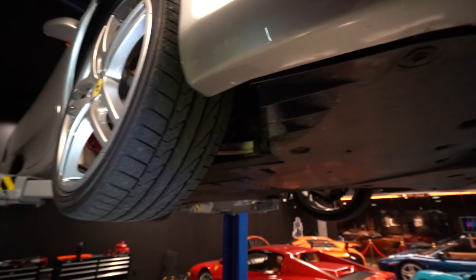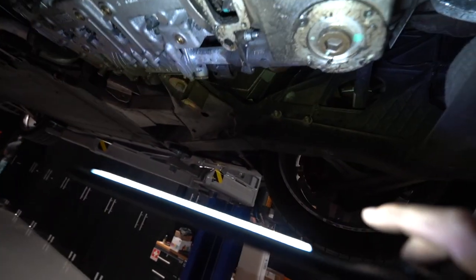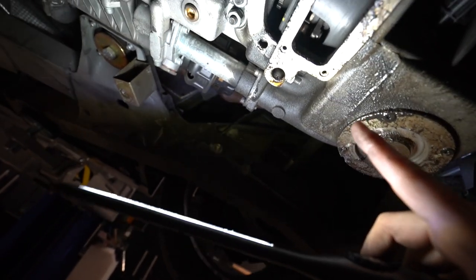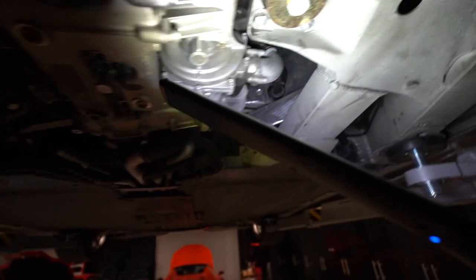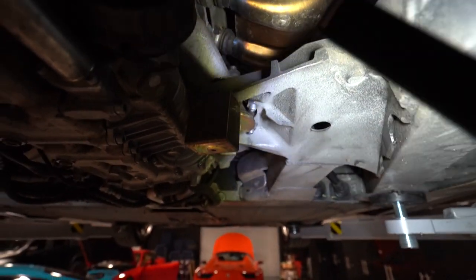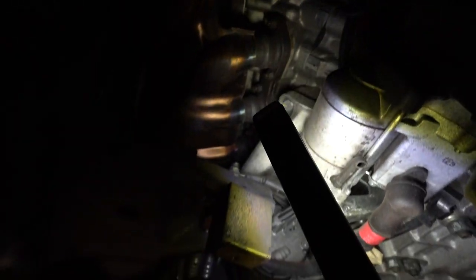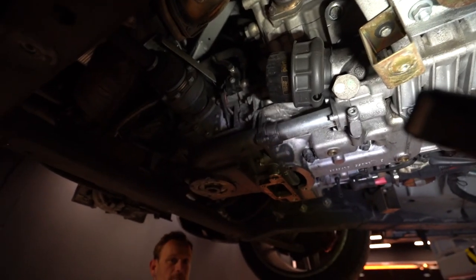That underside is really clean. A little bit of scrape on the underside — that happens. On the underside there looks like a little bit of oil here — probably didn't seal that correctly. Otherwise everything else looks kind of dry. Engine mounts are in reasonably good shape — that's a rarity. CV boots look good over here and over here. I don't see any leaks coming out of the valve covers — neither side, both are dry. That's excellent. This is really good shape.